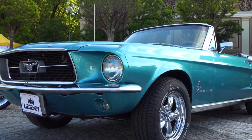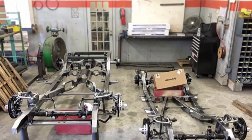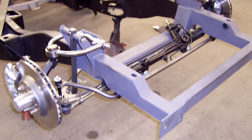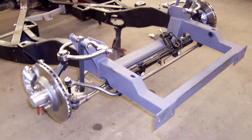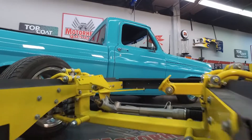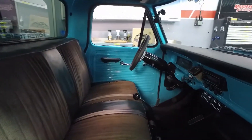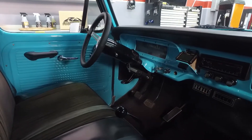I found that I had some ideas on Mustang suspension in particular that I thought we could improve. I started putting those ideas into play on customers' cars, and that developed into a manufactured product we could then sell to another guy. What kinds of things did you start doing differently from the start? Bumpsteer was a big problem with some of the early Mustang 2 kits — there wasn't the understanding of geometry that we have today. And just drivability: you want a car that's totally predictable, that you can hand the keys to somebody that's never driven it before and not have to warn them about anything. The car should almost drive itself instinctively.